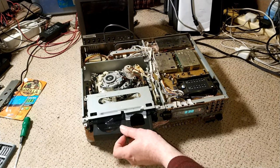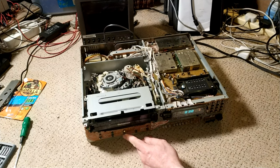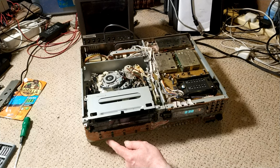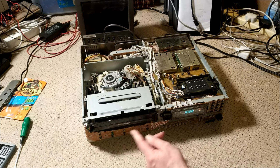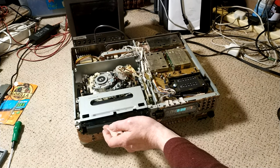I haven't done the caps in the power supply yet, and I will do that. I'm also putting a new mains plug on. Let's power it on — this will be the first time I've powered it on. When I bought this, the listing did show it as working — clock lit up and all the rest of it. That's encouraging. Let's try my blank tape — that's looking good. Fast forward, rewind, play. The solenoid is actually a lot better — that cleanup has made it so much better, and loading is good as well.